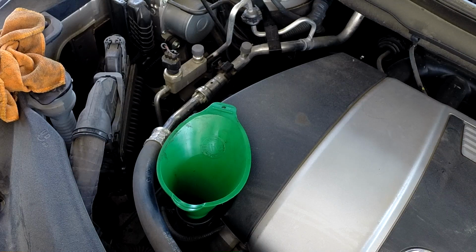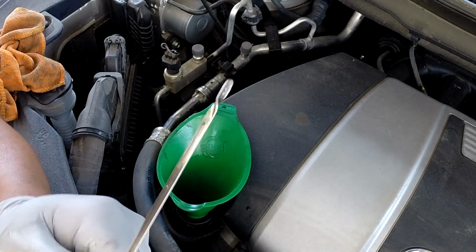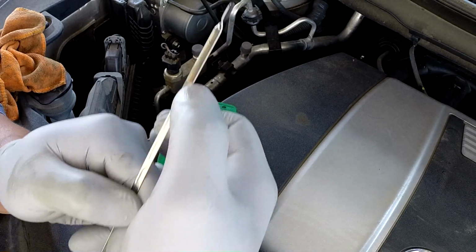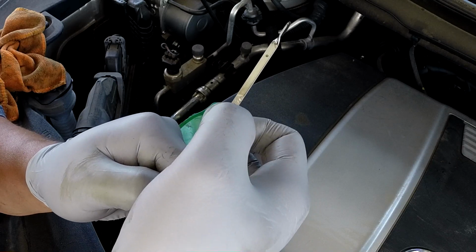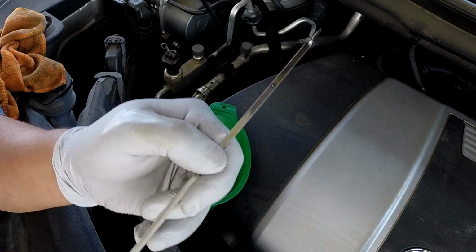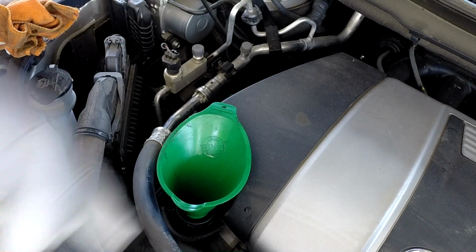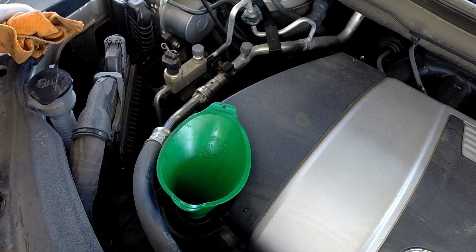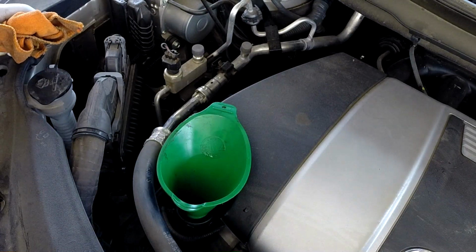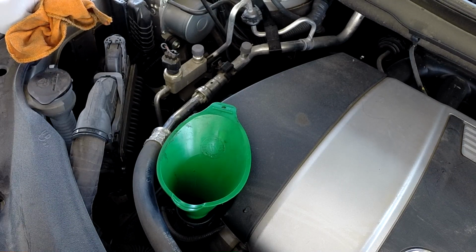And when you put 5 quart in there, you check the dipstick, and it's already right there. Okay, it's already right here. Okay, so almost up to the full dot already. So if you put 6.5 like the older model, like the 2014 or 15, it is too much. Okay, so on the 2017 model and 18, it only takes 5.4 quart, so it does reduce a lot.